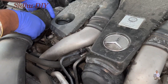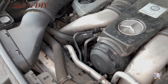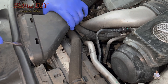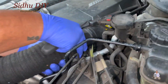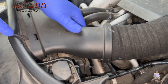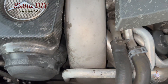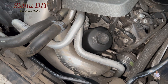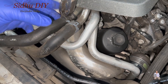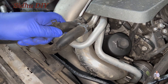The first step will be to remove the air vents. We're going to remove everything — all the hoses. This is very easy and simple. Use a screwdriver, just pry it out and keep it on the side. After opening these, there is not enough room, so we're going to remove the radiator fan. We're going to open the hoses — get a plier, squeeze it, and pull back the clamp. Since the hoses have been sitting for a long period of time, use a straight screwdriver to help.